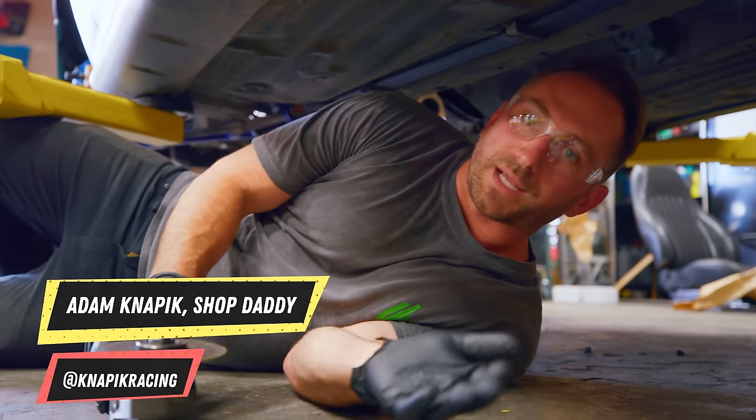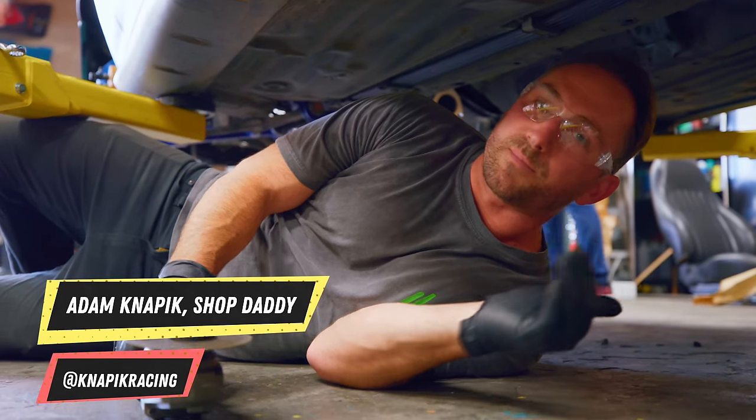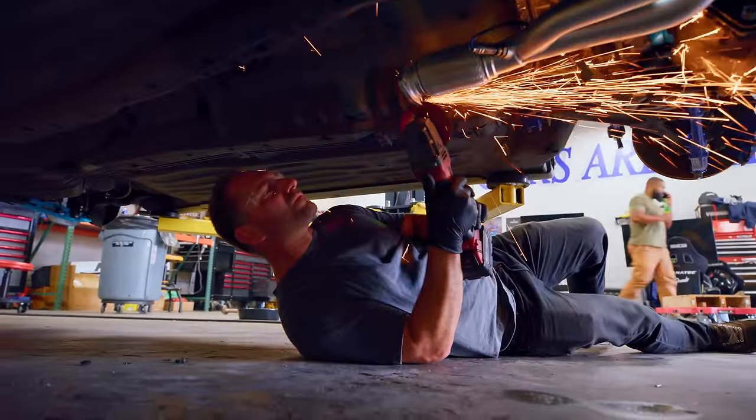So we got a 3-inch exhaust for this guy because Brian at Haltech is telling us that that's gonna make the best power. But with that, the flange is also 3 inches and far too large. So I need to oval out the holes so it'll fit on.